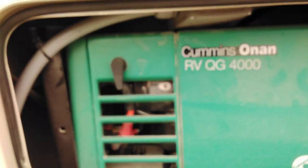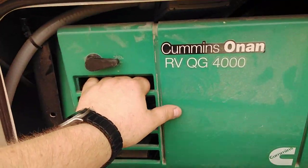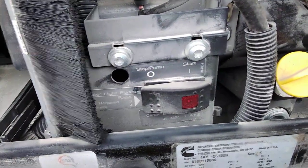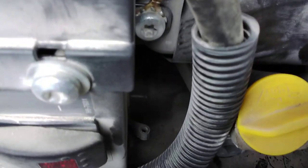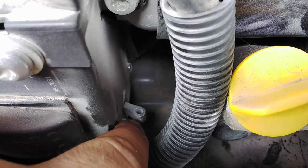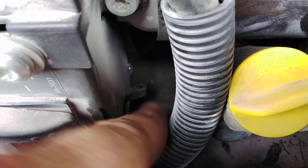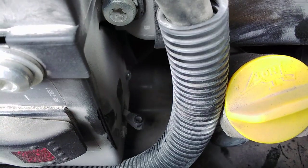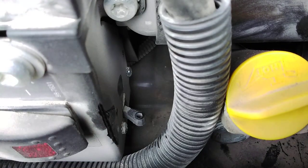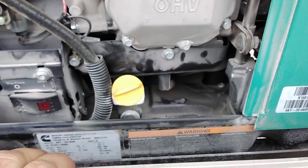And generator. Pull those, pull forward, pull down. You can start and stop it out here. You never will. There is a switch in here that is pointed back. That is a breaker. It's basically just a normal household breaker. Back is going to be off. Front is going to be on. If you ever have any problems, generator's running and you're not getting any power, always check here first. It's always going to be your point of problematic area.